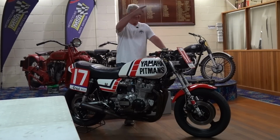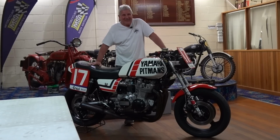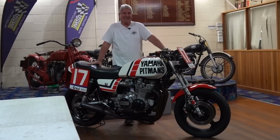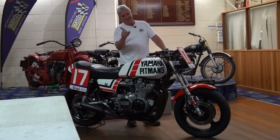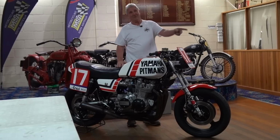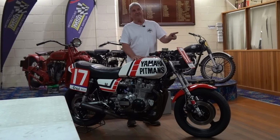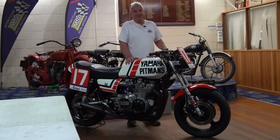But we never had dynos back then. The dyno was out Port Wakefield Road, and you see how fast you went between two poles and work out how fast you go. That's how I used to set up all our little production bikes. I'd change gears and I'd want it to pull to say 8.5 on an RD. I'd put a marker at 8.5, then 8.5 in the next gear, put a marker, and then I'd do whatever I did, go for another run, and if it got to 8.5 quicker than where the marker was, it was better. And that was the dyno.